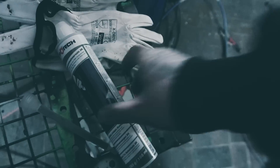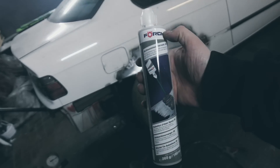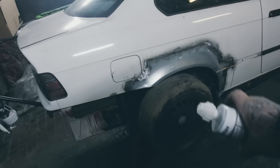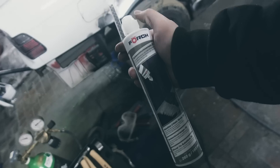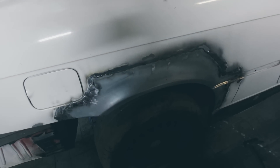Now we start tinning — in quotes. Because we're using a tin substitute, specifically a flow tin substitute. Here it is, my friends: Schwemm-Zinnersatz. I know it's not the best and you probably know better brands. I'm just doing what fits the budget here. I've already cleaned everything, blown it off, silicone remover has been applied, letting it flash off briefly. We need to screw this mixing nozzle on, pump it through — let about 20-25 cm out first so the mixing nozzle mixes properly — and then we can apply it over all our weld seams. The most important thing is that our weld seams are tinned. The rest we'll do with EP primer and glass fiber filler. Let's go and bring this back into order so it looks like nothing ever happened here.